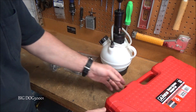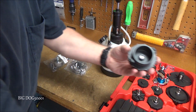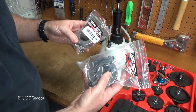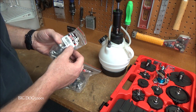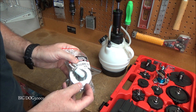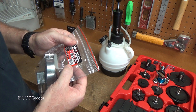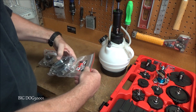I got these originally — these two. You can see it comes with a bunch of adapters. But this one is one of the ones that came with for Hondas. It doesn't work perfectly for many Hondas though. For a lot of the newer Hondas, you need either a 55mm or a 74mm, and that's why I got these. I believe the part number of this one is 18005, and it says BC-26 on that one. And then this one — you can see they're both marked Honda — these are specifically for Hondas: 18004 on this, and then BC-25.